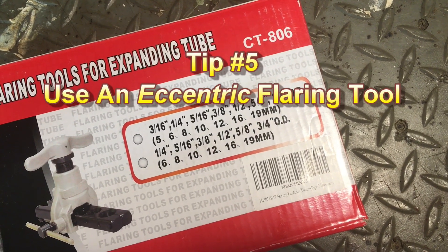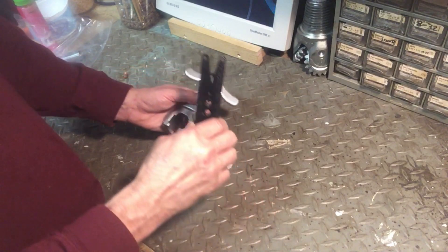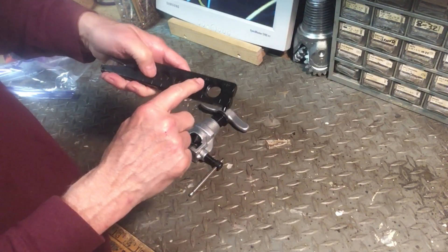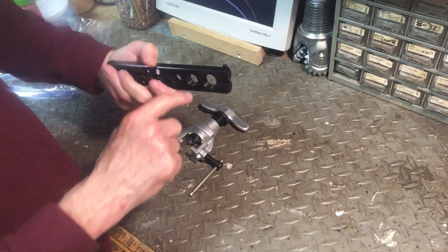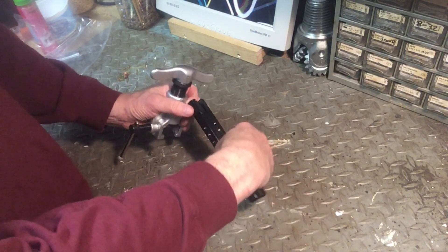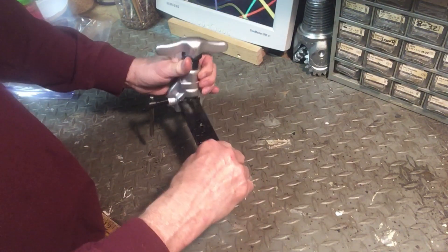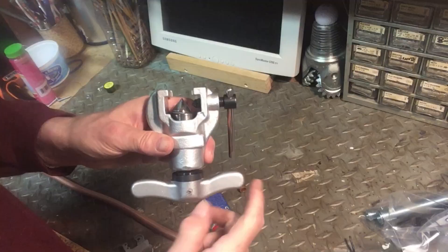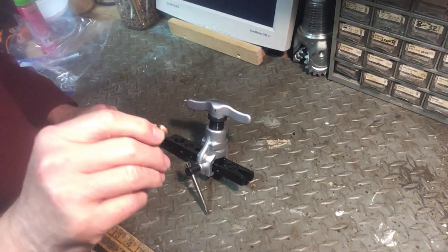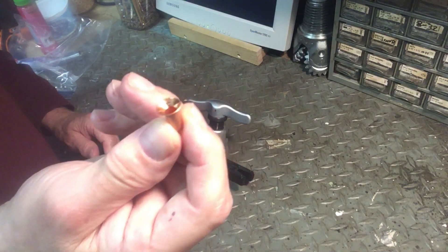You're going to need a good flaring tool if you decide to shorten your line — this is really important. I used an eccentric model. Make sure you get the one that covers the tubing size you will flare. There are two parts to the tool: the screw-in flarer and the part that actually holds the tubing. This part has depressed cones cut into one side; the other side is flat. I'm not going to go into how to use the tool right now — there are good videos on YouTube showing the process — but make sure you get the eccentric model. The cone on the eccentric model moves back and forth to smoothly make the flare, producing a 45 degree flare. You will need to practice with the tool on scrap metal to make sure you know what you are doing when you go to flare the actual line.